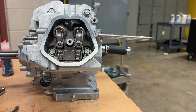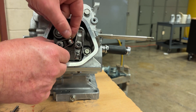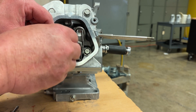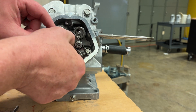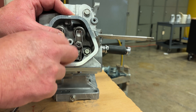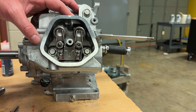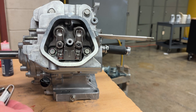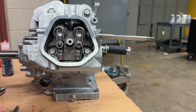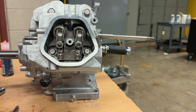The manual says I need a valve clearance — the gap between this rocker arm and the end of the valve. The end of that valve wears eventually and this rocker arm wears eventually. It's a nice thing about engines: whatever we do, we can undo. When it's tight there is zero clearance — if I keep tightening it I'll actually hold the valves open a little bit and the engine won't run. The valve clearance — the gap between the valve and the rocker arm — has to be 0.15mm on the intake and 0.20mm on the exhaust.